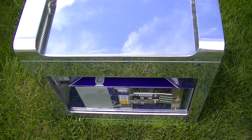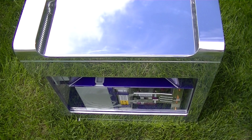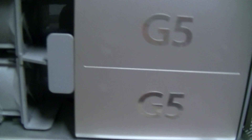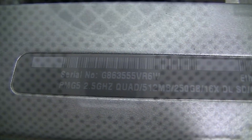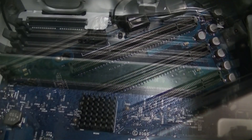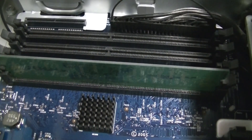Alright, I'll spare no more time. Let's look at the finished product, and then we'll cover how this bad mamba-jamba came to fruition. The G5 Power Macintosh came in several flavors, originally using single-core processors, PCI-X and DDR1 RAM. The late 2005 machines are the ones to really go after as they were the final revision with most of the bug fixes. These newer models sported modern PCI Express and DDR2.